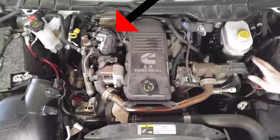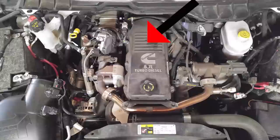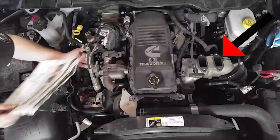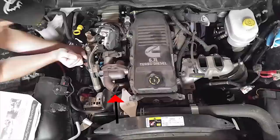To begin, up in the left corner where the arrow is, we have our EGR cooler — all of this is going to have to come out. On the right side we have your air intake horn, and you're going to take all that off on top. There's also a plug down at the bottom that you're going to have to pull out — this disables all your rerouting to the EGR. There's a tube that crosses over; take that tube off first, it gives you a little more room to work.